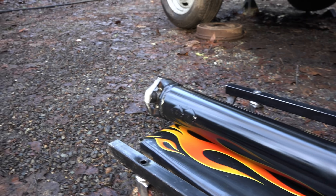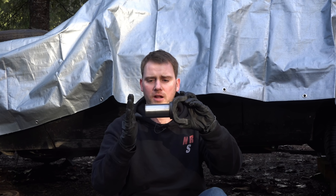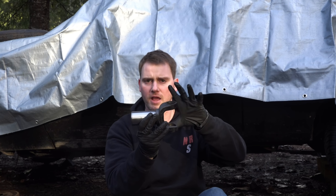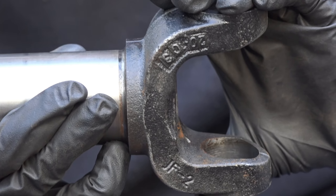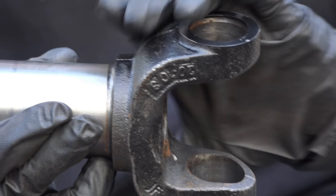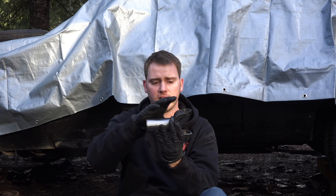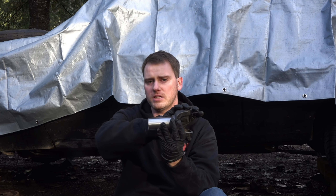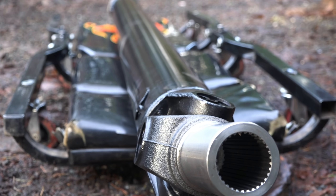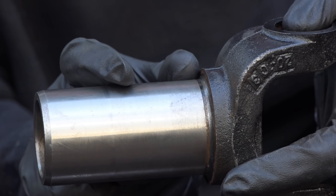What a lot of people probably would have done is just put a longer yoke on it, but that's typically not advised. The way the driveline shop explained it is that you've got this big ball of energy hanging out where the U-joint goes, and the further that ball of energy sticks out away from the tail shaft, the more leverage it gets. When you do a hard launch, that extra leverage makes it easier to break stuff inside the transmission. So I took our driveshaft and had it lengthened by five-eighths of an inch, making the amount we're sticking out exactly seven-eighths.